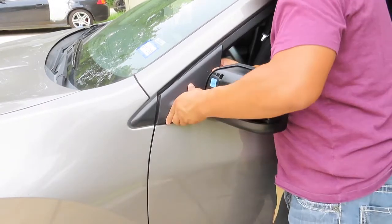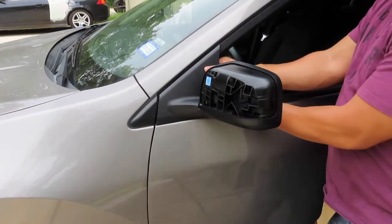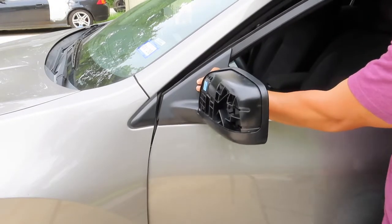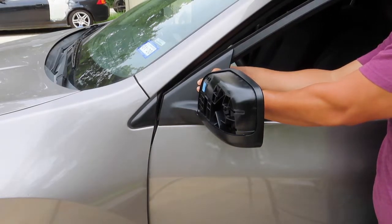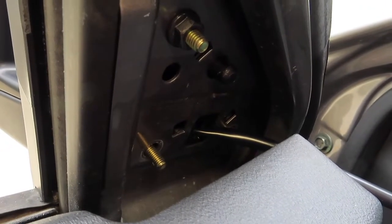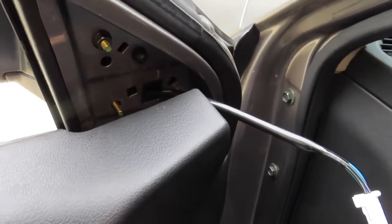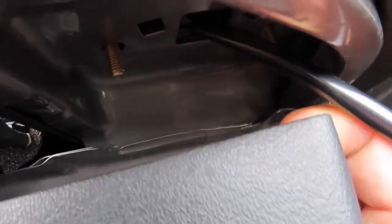On the driver's side, slide the mirror into place — it has three bolts that slide in here, here, and here. On the inner side you have three nuts, 10 millimeter, and that's what holds the mirror onto the door. Remove the corner protector, run the cable into the square hole, slide the mirror into place, and put a nut on to hold it in place. Run the cable down and connect it where I showed you at the beginning.